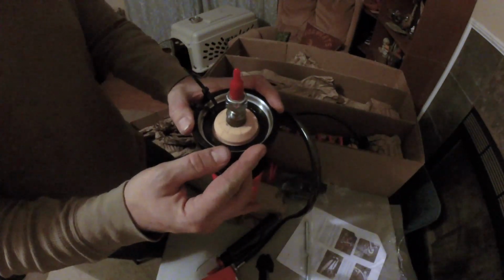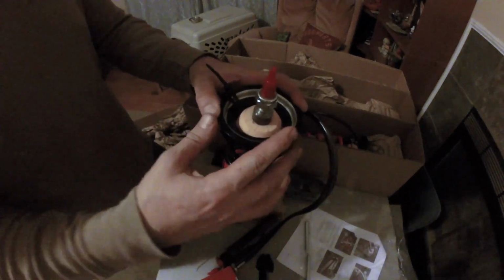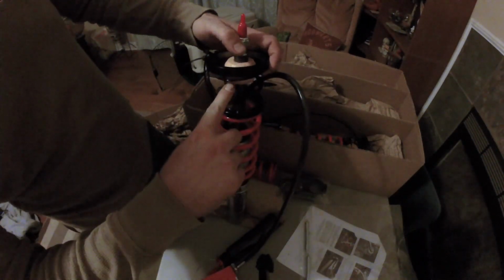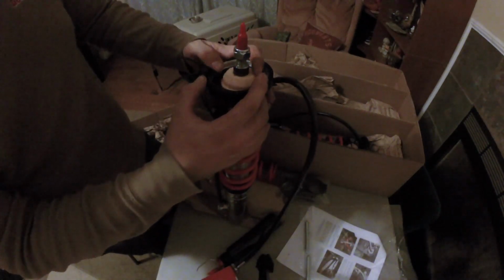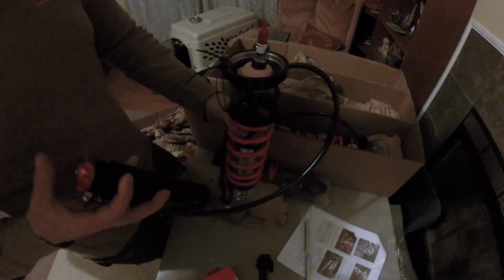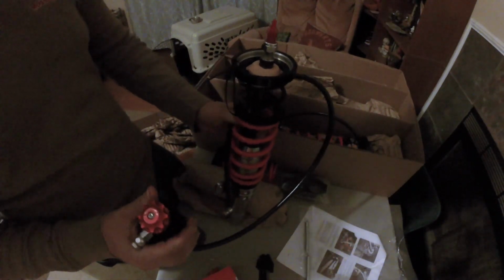Also, I didn't show you guys before, these are the new strut tops, or kind of like strut top adapters that neck it down to the 2.5-inch round spring like it's supposed to be. So hopefully it should glide fairly well and not bind up like some cheaper coilovers that try to force a smaller spring in the factory perch. So at least this has an adapter for that.